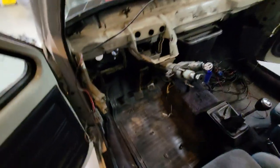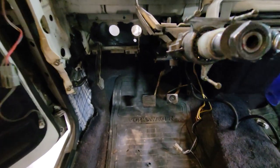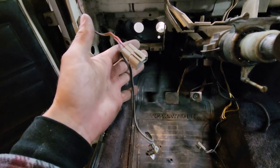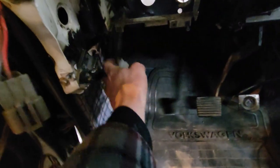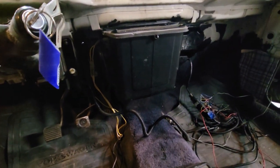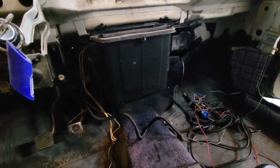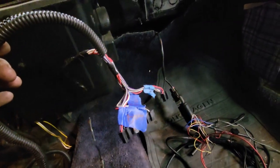I've already ripped basically everything useless out of the vehicle. We have our dome light and our door switch, so that'll get put back in — that was disconnected. And then from what I can tell, this is our rear lighting harness, so I've got to go yank the plug off of that. That'll get mated to the CE2 rear lighting harness plug. Otherwise, we have some goodies here that I've got to rewire — there's a whole bunch of gauges for a little three-stack that takes place of the original radio, I think.